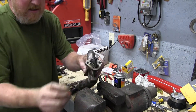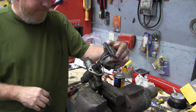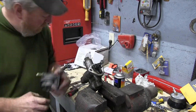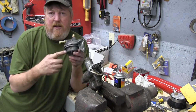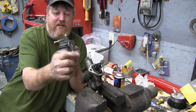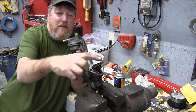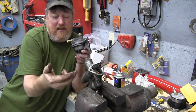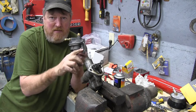We're going to give you a little explanation of the lift pump while we're here. This goes on the lift pump just like that, and this piece is really important. You might be inclined to say you don't need the fuel strainer, and probably in theory you don't. But this spacer right here has to go between this lift pump and the block. If you don't put the spacer in, this is too long and it will wear against the cam with a lot of extra pressure, and either damage the pump or wear the cam out. So you definitely want to make sure you put that spacer back in there.